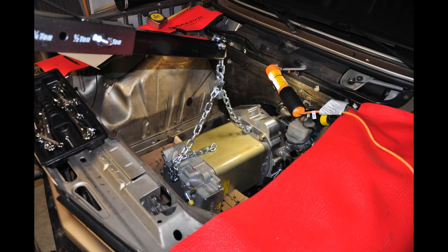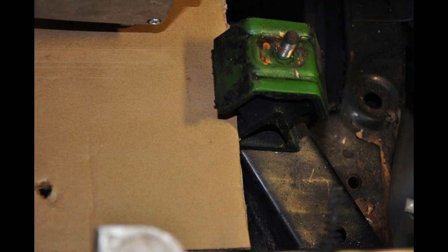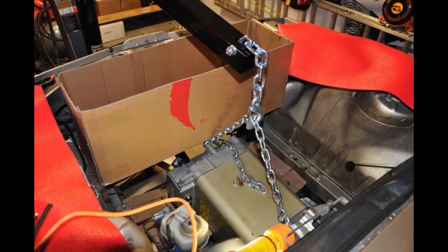Here's what the Siemens motor looks like in the engine compartment of the 320. There's no video of this, so I have this slideshow. I used an engine lift to lift the Siemens and the transmission together into the car at the same time. I had to mount the drive shaft to the transmission to get an accurate measure of where the Siemens had to be mounted. I planned to use the original motor mounts, and I used cardboard templates to figure out where the motor mounts for the Siemens had to be placed. What I found out was the double-row battery box I had planned for the front of the engine compartment was not going to fit with the motor where it had to be placed.